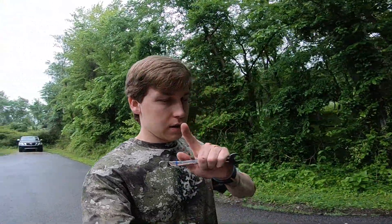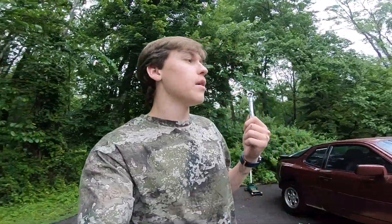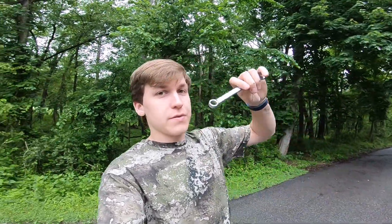I think we made a good bit of progress today taking the entire exhaust out from underneath the car — the most I've ever actually taken out. Took the O2 sensor out, though I haven't gotten it off the actual exhaust yet. I'm going to let some lubricant soak into that. But next time it's manifold time — 13mm socket. I'm going to have to get some deep creep or something like that to get in there and loosen those up. Thank you guys for watching. You guys all have an amazing day. Make sure you subscribe and follow for the next video, and go ahead and follow me on everything so you can see all the content everywhere. Thank you guys, and have an amazing day.